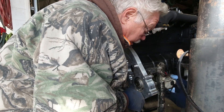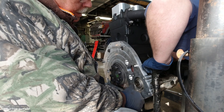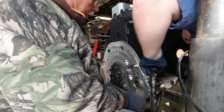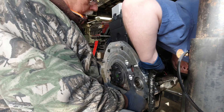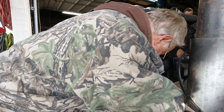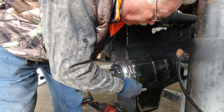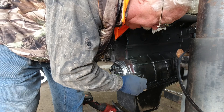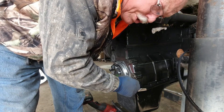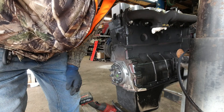Let me take a second. It locks a little — it didn't quite turn down, I don't think. It isn't hitting down there. It's possible. Is it hitting right here? See this little spot where the paint's chipped right there? Our starter's actually hitting that. It has to rotate a little bit, and it's just a little bit of resistance right there. We don't want to have any problem with the starter about taking it on and off. So I'm fixing that clearance right now.